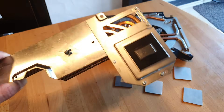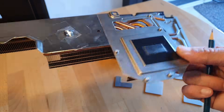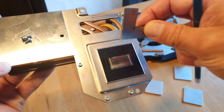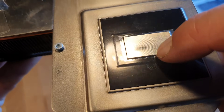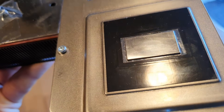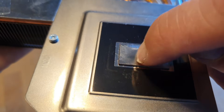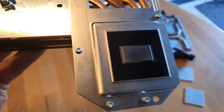This cooler here was from the PlayStation 5 — I got the PlayStation 5 second generation. This was the cooler that was in my PlayStation 5. I wanted to just take it off and look inside. I tried to check if it was bent or not, and I was shocked with this one. You can see a small dot here. I cleaned it away because there was some kind of raised dot — when you just passed your fingernail over it you could hear it. And that's why I lapped it here, really, with about 800 grit paper — not really much, because this is nickel plated, and it should be nickel plated.